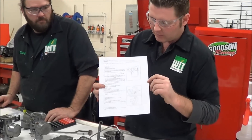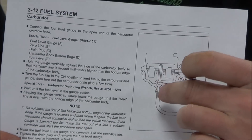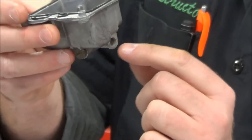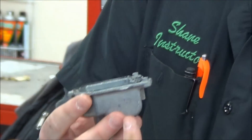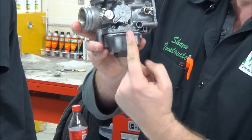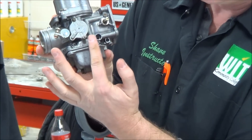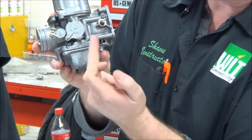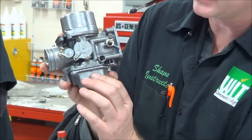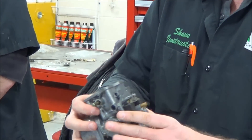Here's a picture out of the manual that we used the other day. There are typically two ways that we're going to set float height. We have this possibility of using what they call a special tool in most manuals — it's a hose that hooks up to the bottom of the float bowl. You'd have an adapter go in here, then take a piece of hose and set it on the side of the body assembled with the float in place. When you open the drain screw, the fuel fills up in that tube, you'll have a baseline mark, and you can see where the fuel level actually sits. The manual will say plus or minus a millimeter from this edge or three millimeters. But it's not as easy to do, and I don't believe it's as common a practice.